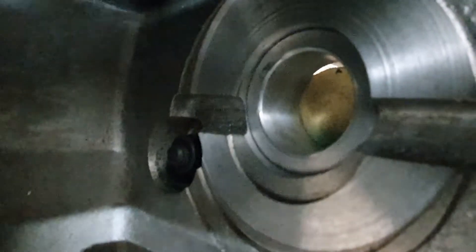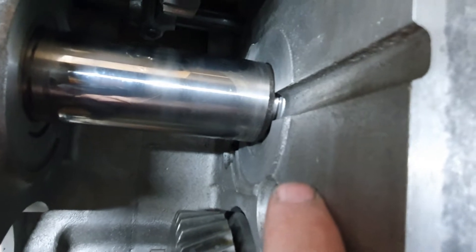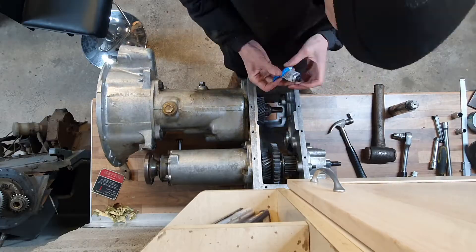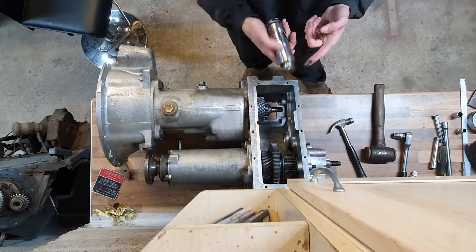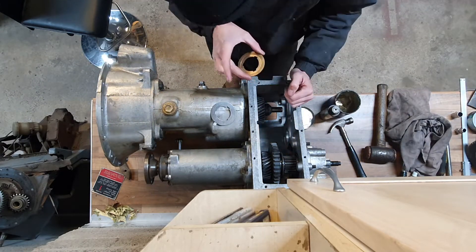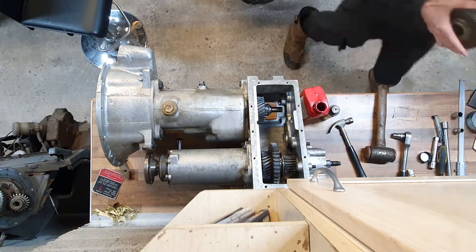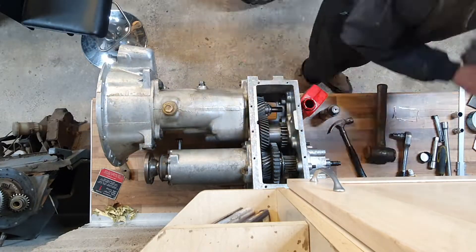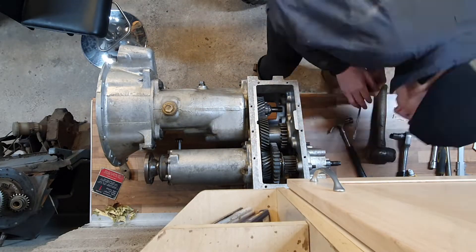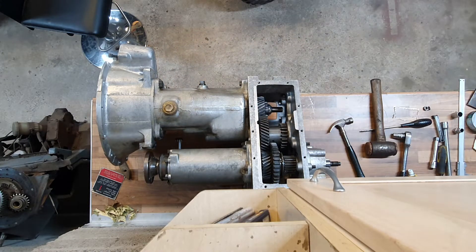But because they've moved the centre, you can now see light through there. I'm going to smear quite a lot of silicone down the bottom - it'll come squidging through that hole to completely seal up the bottom. And in addition I'm going to put a very little smear on the smaller diameter shaft that goes into that hole - a double whammy, it should seal it. First thing is to put the silicone RTV sealer down in the hole, and then the thrust washers that keep the idler gear in place. I've put a load of grease on the back of those so they stick to the casing while I drop the gear in, then pre-oil the bearings in the gear, drop the gear in, check the thrust washers are clear, then tap the shaft all the way in and bolt it in place.